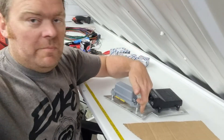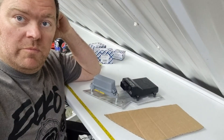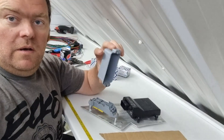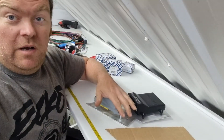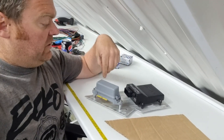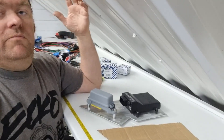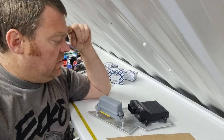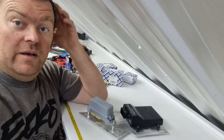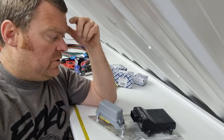Cardboard template done — I've made an aluminium plate to mount our ECU. I've used AV mounts so it has some movement to protect it a little bit. I've also added a dedicated fuse box. This is a modular fuse box that we use quite a lot, made by a company called MTA — they're Italian. We're putting in some extra outputs, driving a couple of extra relays in case Ashley wants to do anything else — methanol injection, a shift light, whatever. Once the outputs are there and wired, we'll just leave a little connector. The world's your oyster — a bit more future proofing.